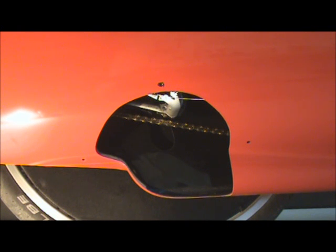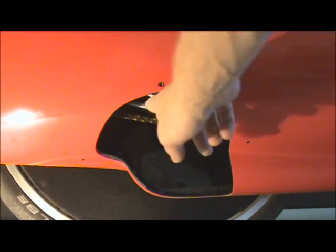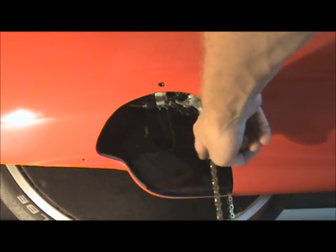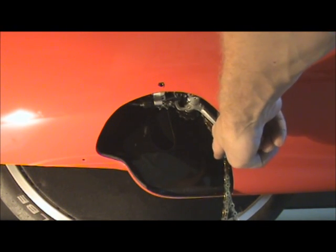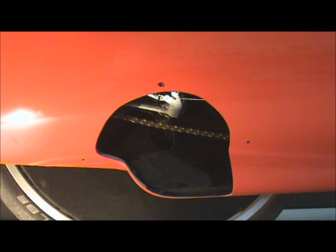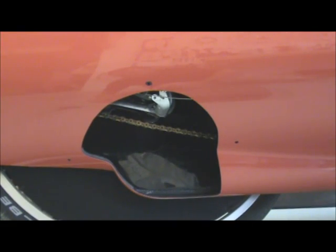If we had moved the bottom bracket further from the rider and made the drivetrain longer, what I would be looking for is that in the largest chain ring in the rear and the largest chain ring in the front, the derailleur would still be in a position where it has a little bit of slack and is not completely extended to its limit — where that would create problems and possibly damage the derailleur during shifting. And that completes our adjustment on the bottom bracket of the Quest. I should quickly mention that if you find you need to add links to your chain or take them away, you can find all kinds of videos online that will show you how to add and remove links from the chain, which will allow you more flexibility as far as how far you can move your bottom bracket.